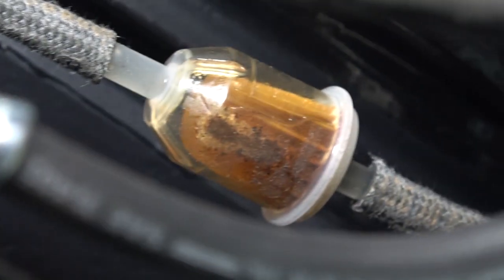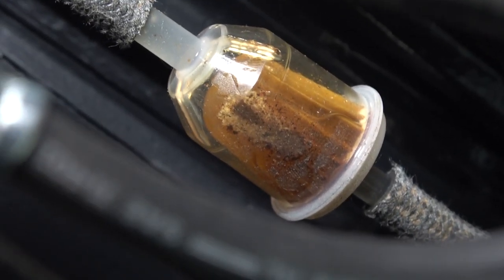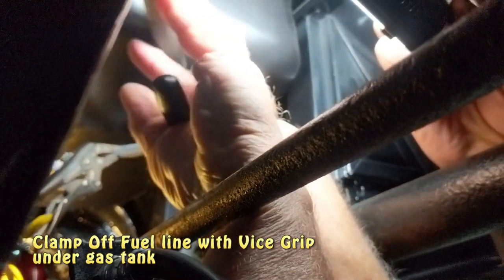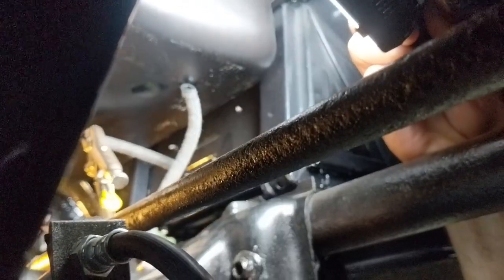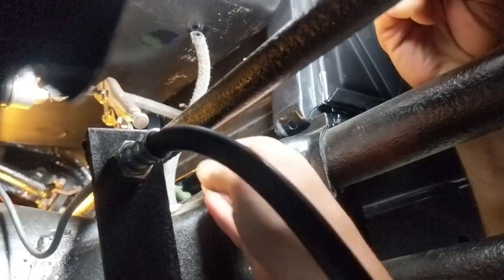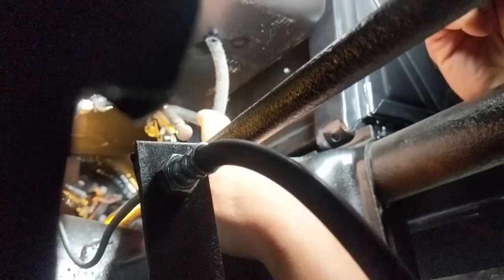The filter has fuel in it, but the carburetor bowl was empty. I'm hoping there's no blockage in the fuel pump. It's easier to cut the fuel line so you can use that line to blow the air into — this is the line that goes down into the chassis.